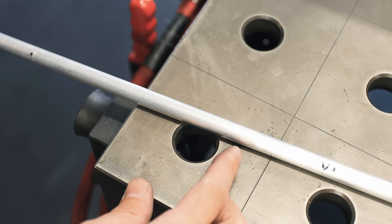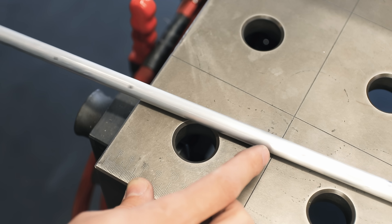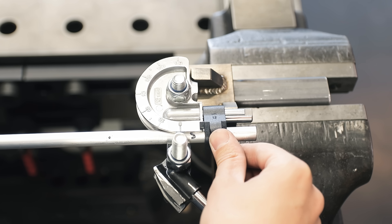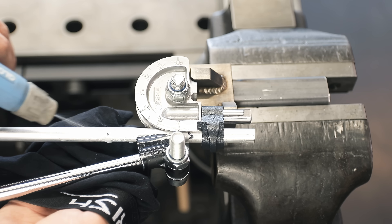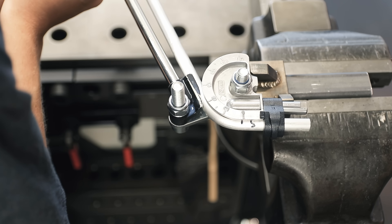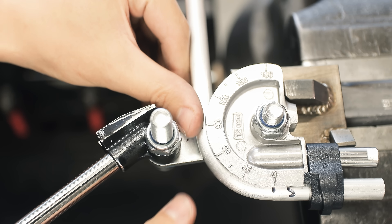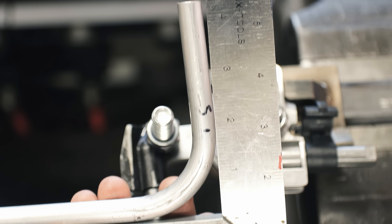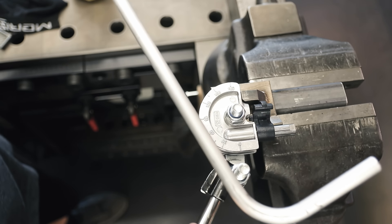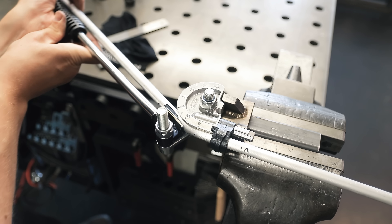So all I did was mark the start point and end point of each bend on my material. The 'S' marks the start of the first bend, the next mark is where that bend should end, and then 'V' is for the vertical bends which I'm going to do in a later step, and then comes the next corner bend and so on. I'm not very experienced in this whole bending business, so I had no idea if this would work — which is why I'm building a rack out of cheap materials first. I was pleasantly surprised that the end point I marked actually ended up exactly at the 90-degree mark. The material does tend to get pulled out of the clamping bracket a little bit, but that turned out not to be a problem. I did overshoot this bend slightly but with this material if it's just a few degrees it's quite easy to correct by bending it back by hand.